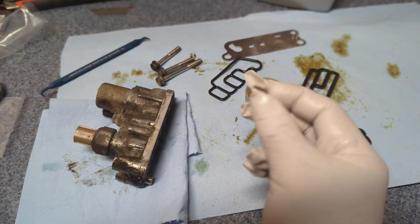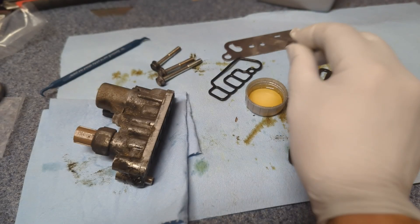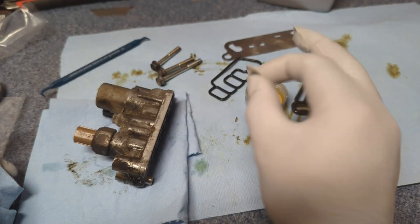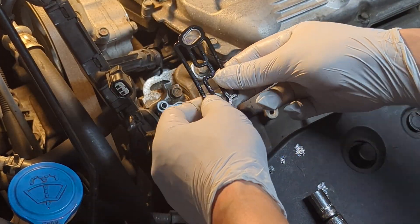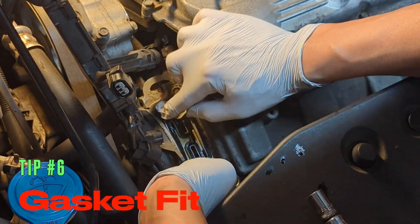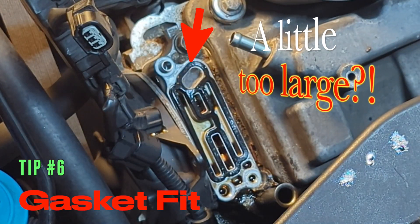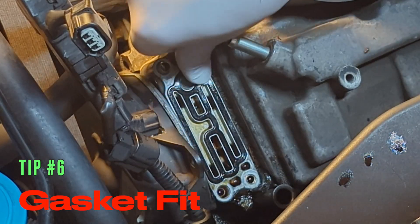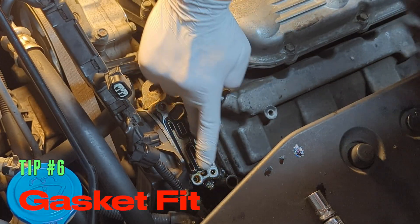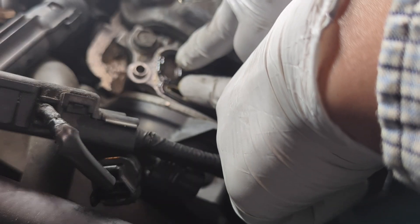So this is the top and bottom two bolts. The other dowel pin does not stick to the solenoid, so I'm going to individually install it back onto the engine so it stays there. Put this dowel pin back on. Now the new gasket — this is super important: make sure the gasket has the exact fit. This gasket right here does not — it's a little bit oversized. But I went ahead anyway to test it, and sure enough, it started to leak when the engine warmed up.